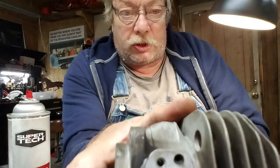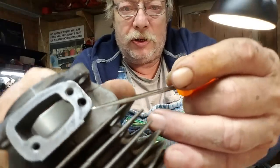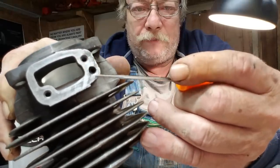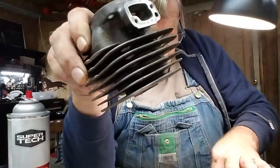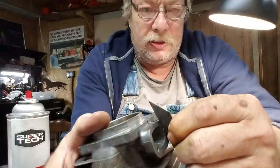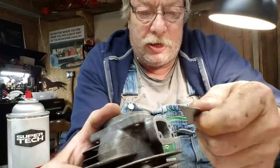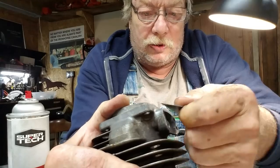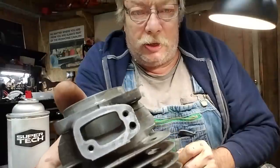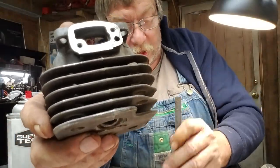I've run my razor blade across that surface. Do you see them machine marks? That's machine marks — that was kind of a rough machining. But when I scraped that with the blade across them like this, I'm not removing aluminum per se. What I'm doing — and you go two ways — it's like spreading body filler. You see how they really crop up? That makes that finish fairly nice.